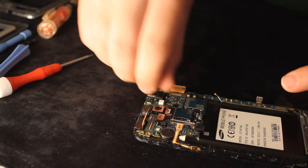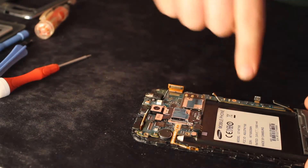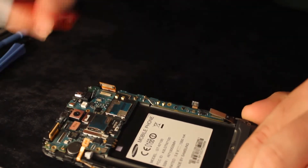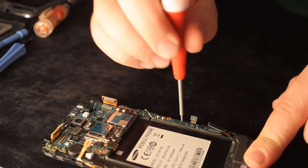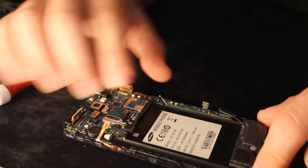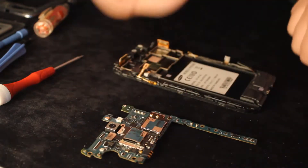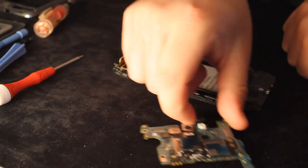There is even this small one. Basically now it seems that all the connectors of the motherboard are out. Oh, I left behind the USB jack one. And then we have a little screw right here — this black screw is the only screw that holds down the motherboard with the chassis, so just take it apart. Now the motherboard should be released easily, and here we have it — this is the motherboard and it's completely off without any trouble.